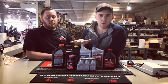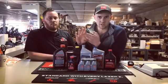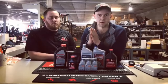There are different types of oil. We want to make sure you use an OEM, name brand oil — not automotive oil or generic brands. Sometimes they have cleaning agents and detergents in them that are really harmful and dangerous to air-cooled engines.